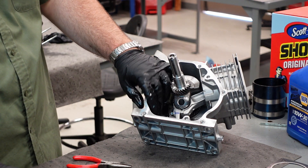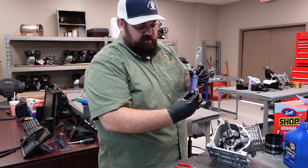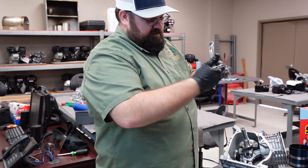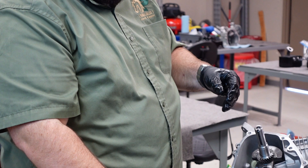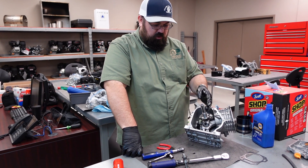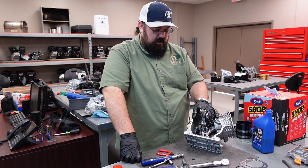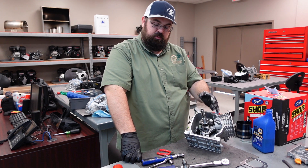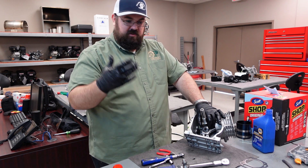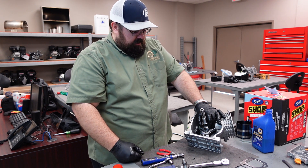Because now we're going to torque. I have two styles of torque wrenches here — a digital and a click style. Click style are simple mechanical devices; you unlock them by pulling down on the bottom, some have a thimble. You roll your handle to tighten or loosen. I have this set at 50 inch pounds. Our target is 100 inch pounds for these two bolts and we're going to go in thirds — roughly 50, 75, 100. I don't get too scientific about it. I'm going to start at 50 because most people by hand can get to around 30 inch pounds, and 25 is so low. What you can put on with a screwdriver is usually about 30 inch pounds, so I go ahead and start at 50.